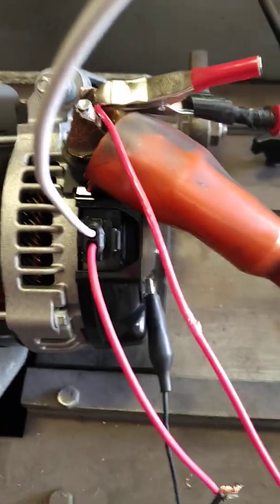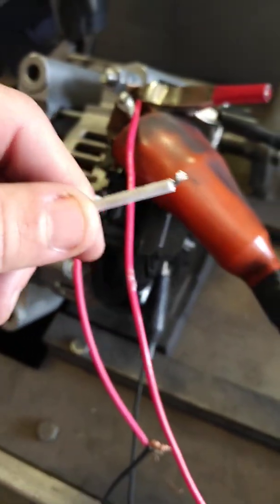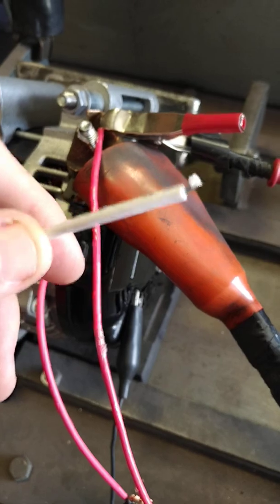When you follow the instructions, you'll get our plug harness and notice one wire that's loose — just keep in mind the instructions will walk you through that step. For the most part, you're not going to use your factory harness; you're going to use ours plugging into the alternator. Once you have it all set up with ground and 12 volts connected, the PWM wire is already connected to the plug harness, so you don't need to do anything with that. The last remaining wire gets connected to your factory harness — the instructions will tell you exactly where to tap in. You're not going to cut the head off of your factory plug.